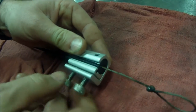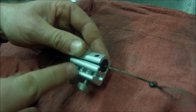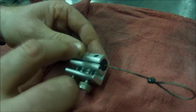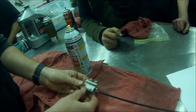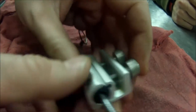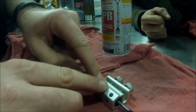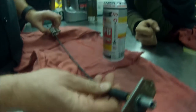You just take it and snug it up. These newer ones have two thumbs on it — the old ones only had one, and you couldn't get it even, so it would kick sideways and really leak. I'm going to flip this around — and without a doubt, we've got a big gaping hole there. The idea is we're going to force fluid through the sheathing down until it literally starts to escape out the other end.